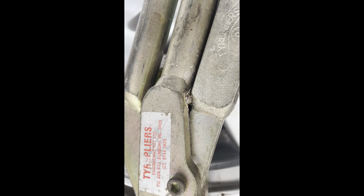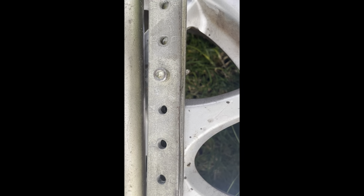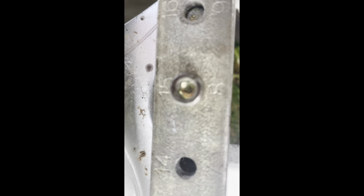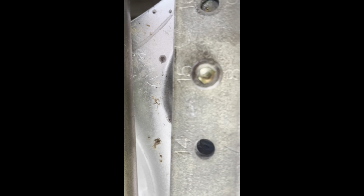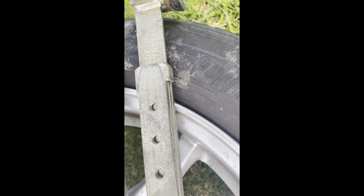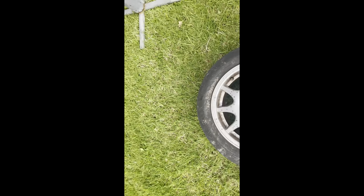These are tire pliers - if you're lucky enough to live in Australia you can get them. I'm not affiliated with these guys, I've never spoken to anyone from the company, I just really like their products. With a ring nut you choose the actual size of the tire - this is a 15 inch so we put it on size 15 - and then there's an extendable bar. From here it's literally a one-person, one-handed operation.